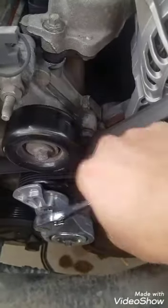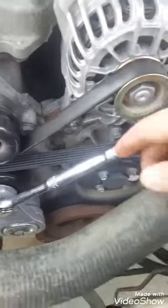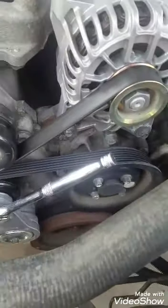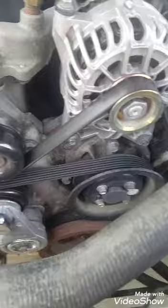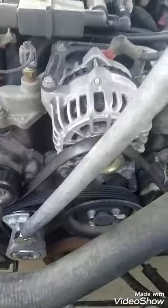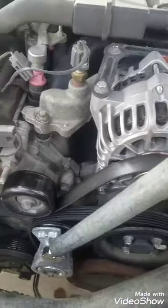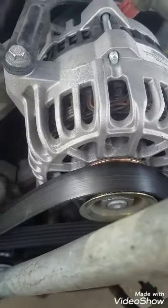This is a 3/8 drive. I stick it on the tensioner and this is just a short little stubby, and I take the pipe that I have to use as a breaker bar, and I just pull it this way. Then I take the belt off of this pulley and then off of the alternator. It's going to be kind of tricky to try to do it without dropping the camera, but basically you just slip it off the tensioner pulley and slip it off the alternator — just like that. Then you release the tension. You don't have to take the belt all the way off, you just have to remove it far enough to get the alternator off.